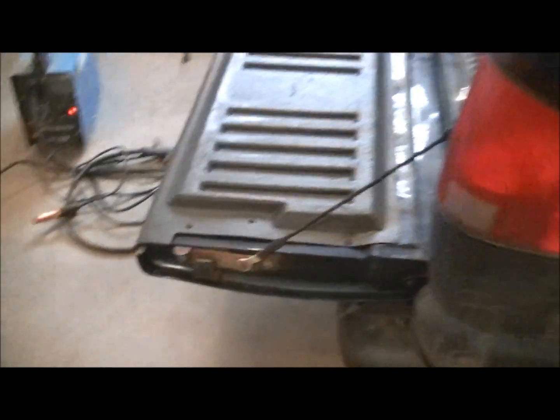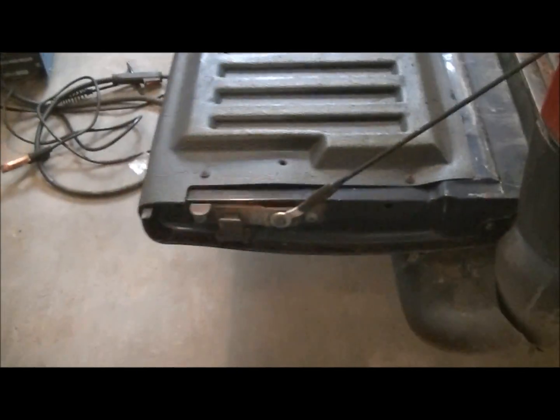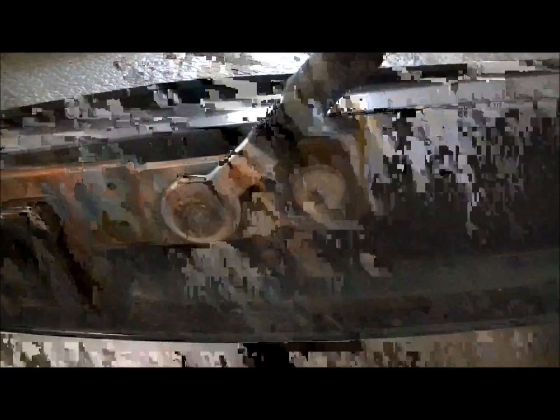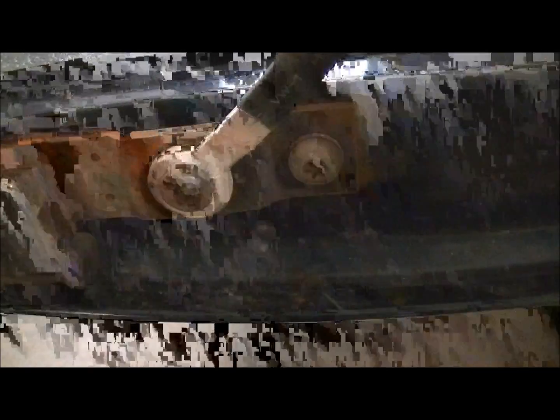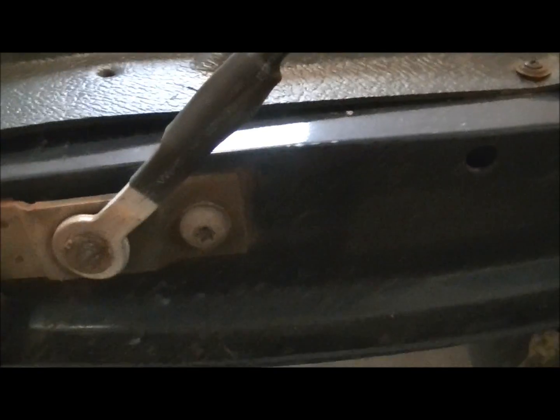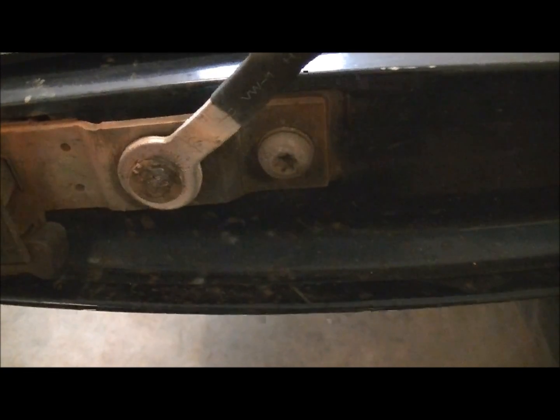So that's the main reason why I did this video — so if you ever come across this. This is an S10, but I don't know if they did this in the full-size trucks or not. But those kits, you're supposed to drill all that out, and the shitty part is this doesn't just unbolt where you can go work on it — you have to take the tailgate apart internally. So, for not having to disassemble anything, it doesn't take very long — no drilling, none of that — just grind it off, weld a new one on, and weld a washer over it.